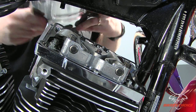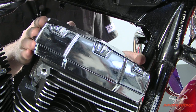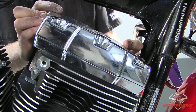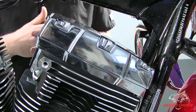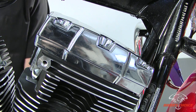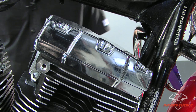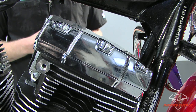I have my clearancing done in the cover. The rocker arm clearance — generally the intake is always closer than the exhaust, so on this one I didn't necessarily have to do the exhaust. The time you're really going to run into trouble is any time the valve has been sunk, which in this case has happened. If you go with a 650-lift combination and put in an aftermarket rocker arm — anything over 585 lift we recommend a roller rocker to reduce the friction at the valve stem interface. When you go to that roller rocker or aftermarket arm, it may be a beefier component than the stock rocker arm and could interfere with the cover even more severely.